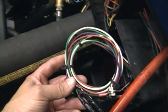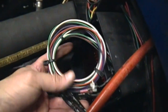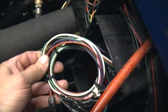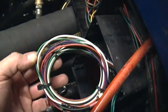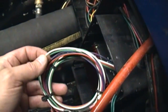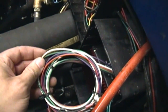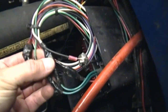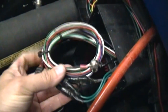Here are all the wires that come out of it. It's actually really easy to hook up and it works by grounding the coil. Basically there's a red that goes to an ignition positive, there's a ground, there's a green that goes to your TAC terminal on the distributor. Then there's a white that the easy way splices in with the green — you can see I actually have them hooked up like that there, going to one. And there's a purple that's not used.